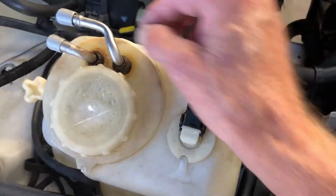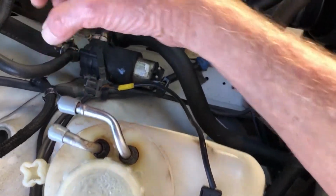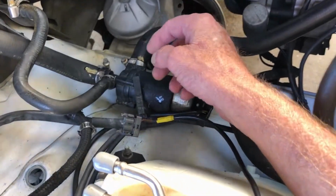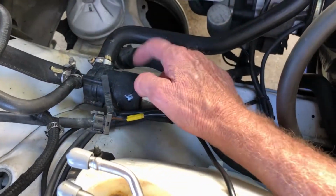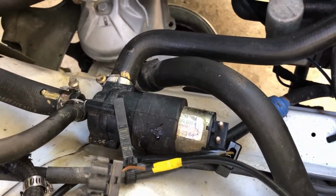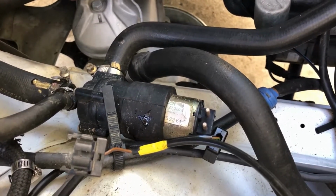Okay, until tomorrow. Here's a little tip. I should have thought of this before. So this cooling coil, there's two hoses, right? So instead of getting that splice, you can just disregard one of the hoses, because one of these goes straight to this auxiliary water pump. I have it disconnected because we need a new one. It just causes the interior to heat up all the time. So hook it up during the wintertime when it's really cold, but during the summer, just pull the plug on it. It stops it.